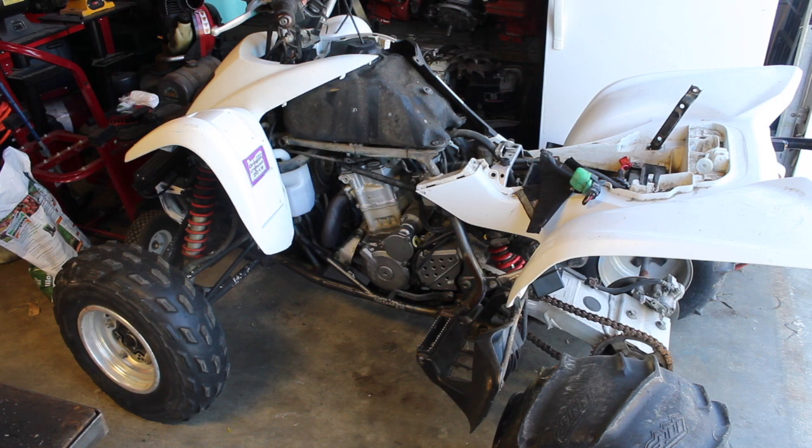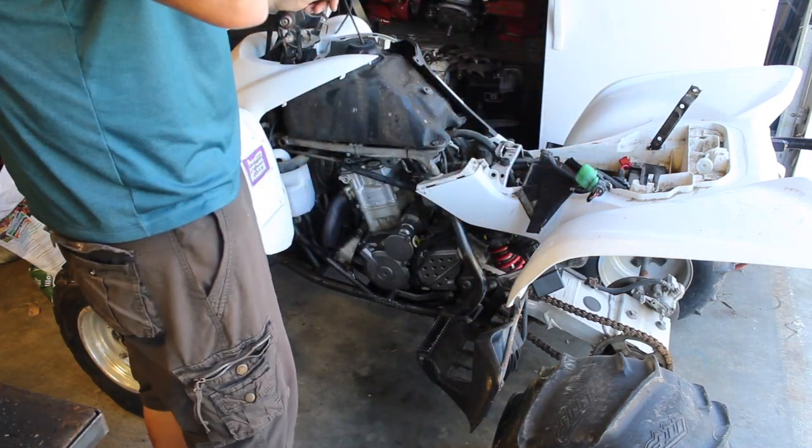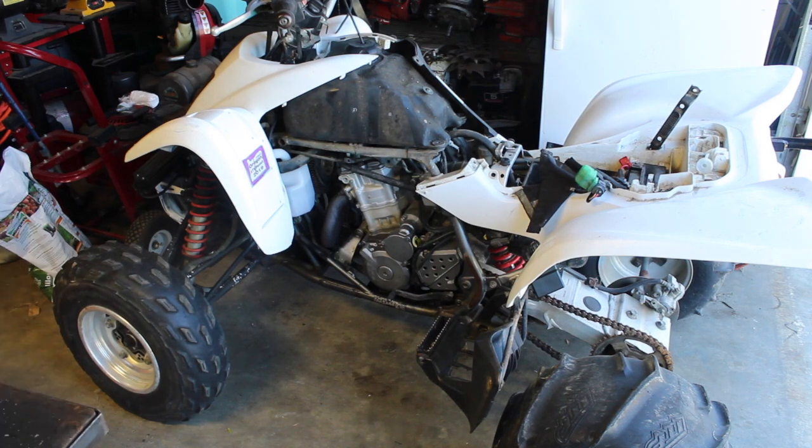Maybe in between the spark plug and the stator, you check the switches. On this one, check to see if the fuse is blown. If it is, obviously it's not going to work. So in between the plug and the stator, probably just check that one out next. And there's a couple of them sometimes, so kind of go through one by one. And at that point, if all that is good and your CDI box is bad, replacing it will be the only way to really get it started.